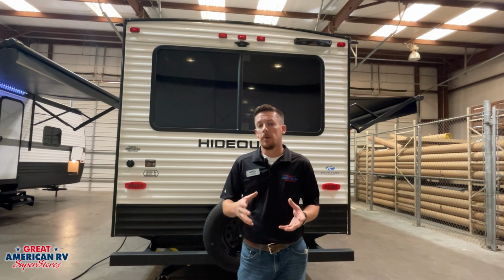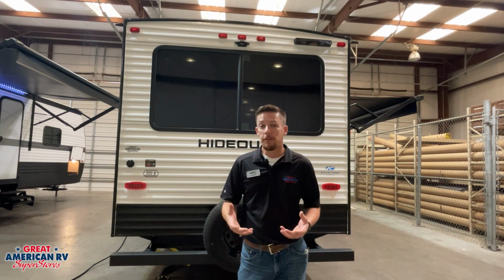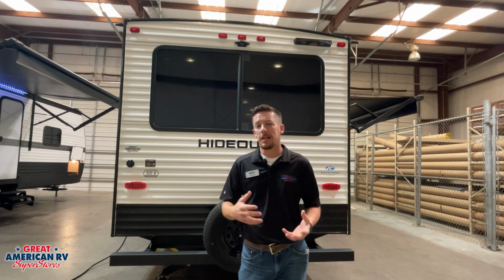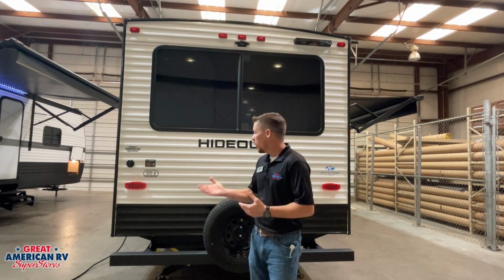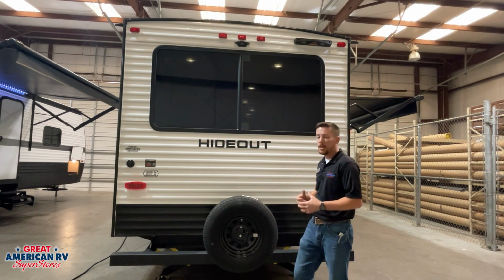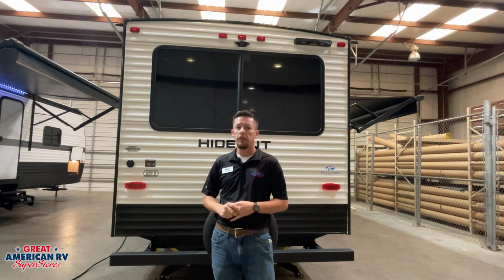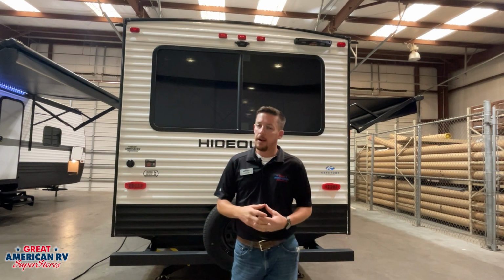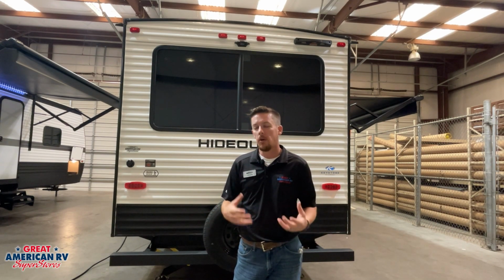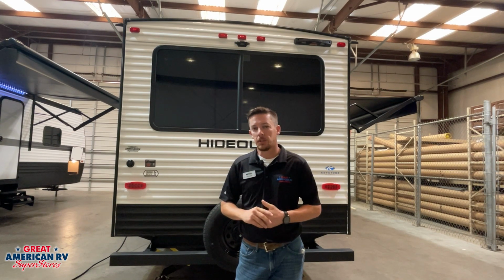This is considered customer maintenance and needs to be done every 60 to 90 days. Manufacturers won't participate in any water intrusion repairs if the customer is not maintaining their unit properly. We also have sealant around our corner moldings, our lights, and around our windows, or any other places where we put holes in the side of our unit to add a feature. We need to check the sealant there every 60 to 90 days as well. This is like changing the oil in your car. We want to make sure that we're maintaining our unit. That way it will last for years to come.